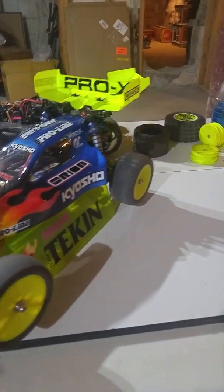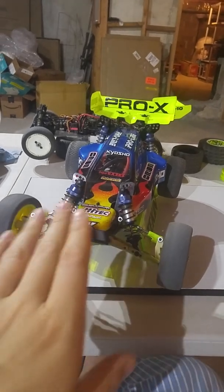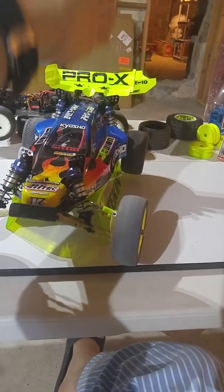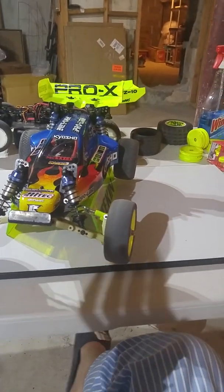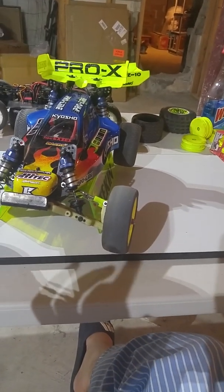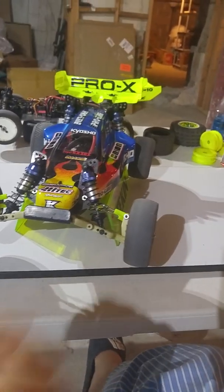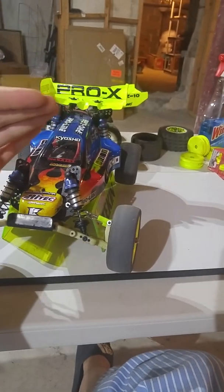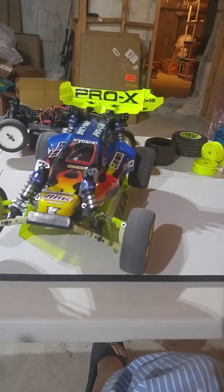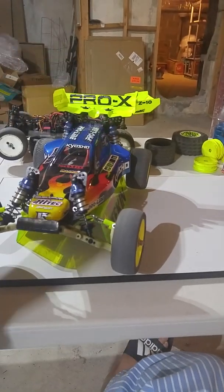If it's more laid down, it also has an effect on cornering, which is what I talked about a little bit in the first video, where generally what I found is if you stand up the rear shocks, perfectly stand up, that makes the turn in a little bit sharper, because on cornering, it kind of feels like the suspension is effectively stiffer. Feels like it. And if you lay the shocks down, the chassis is going to lean a little bit more on cornering. Okay, so depending on your driving style and what you're looking at with your track surface, you might want to stand up or lay down the shocks.